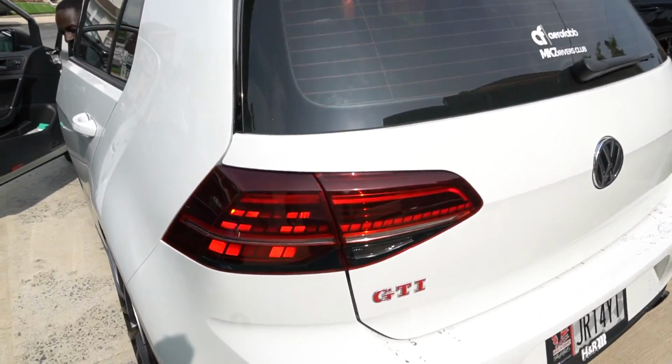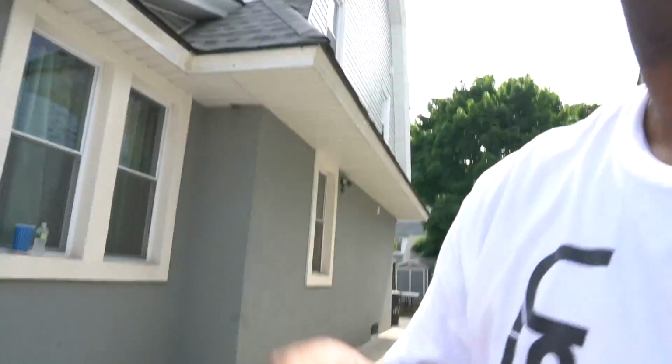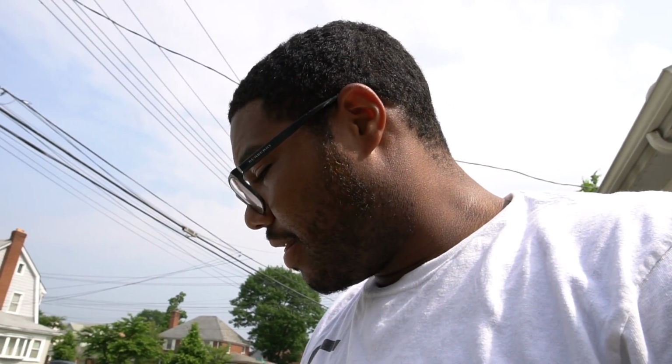So guys, I hope you enjoyed this video. Now, this finally answers the question that no one else put up online. If you did the Mark 7 LED taillight Euro upgrade, and you use the Shop DAP harness, if you buy these taillights from EMP Tuning, you can run that harness and everything is still functional without having to change the harness or the coding. I hope this helps a lot of people who were interested in going with the Mark 7.5 taillight harness.